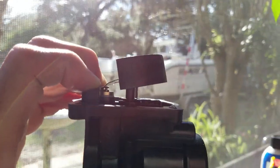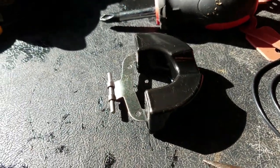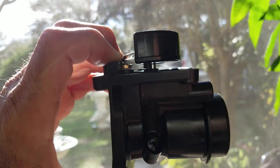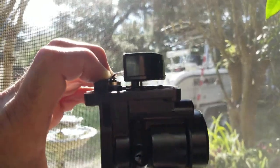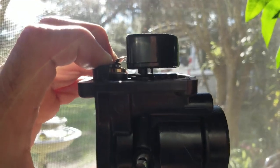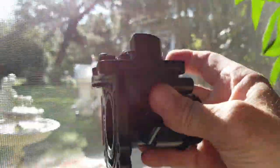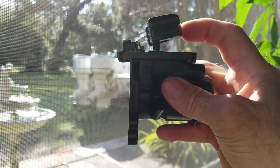This is how it was set up when I pulled it off — the old float bowl and the old float. This is the new one adjusted the way it should be — even, not at an angle. See how it's pretty much parallel with the throttle housing? That's the way it should be set up. They don't come like this even in the rebuild kit. I have to basically shape and bend this section here to get it there, but now this will provide more fuel in the float bowl and it'll be less likely to run out of gas.